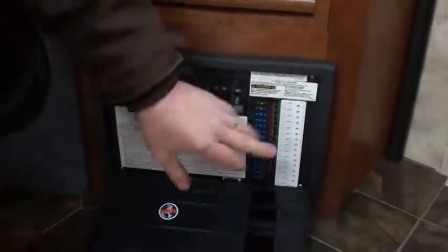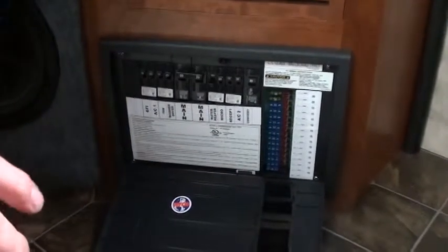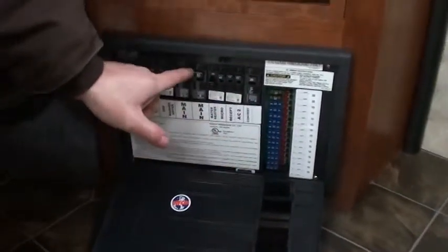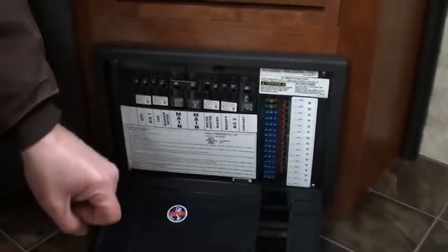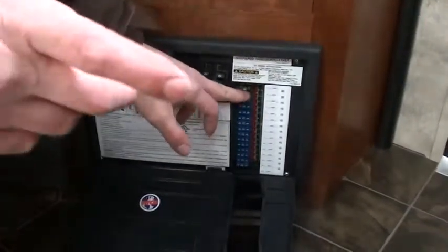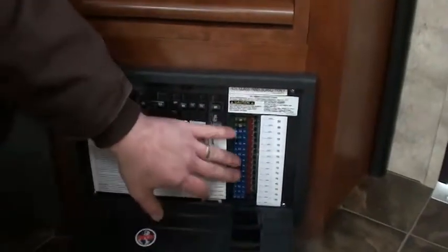Now, down here, this right here is your fuse box. Now, it's 110 breakers, 120 breakers, and then you have a 12 volt side. Now, that converter outside, like I said, it's plugged into 110, so when it's plugged in, it's charging your battery, but it's also working this 12 volt side. So, you're plugged in, you have two 50 amp breakers for the entire unit because you have two ACs. Now, just like the two 50 amp mains, you have two 30 amp here plus the three 35 amps on your converter. So remember, you have those, the rest are 15s.